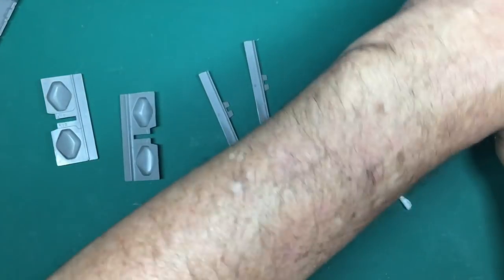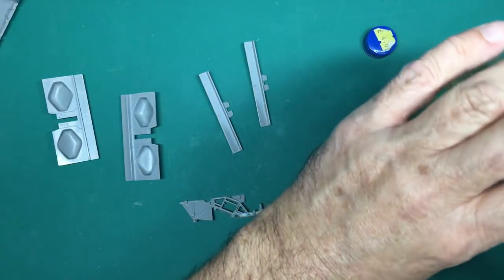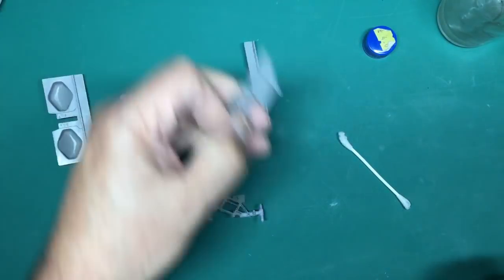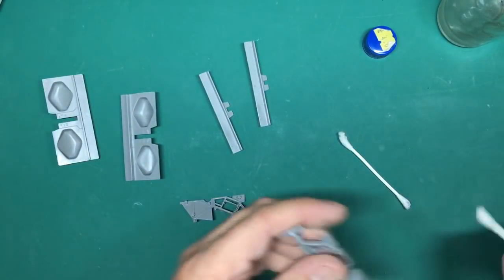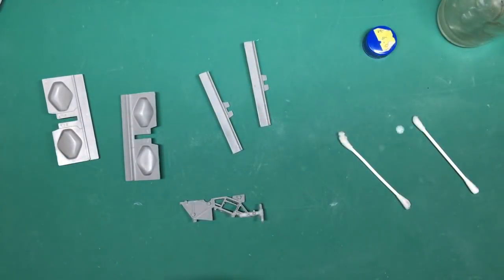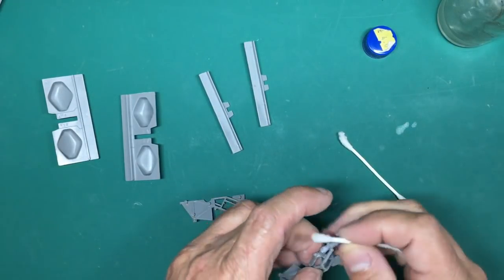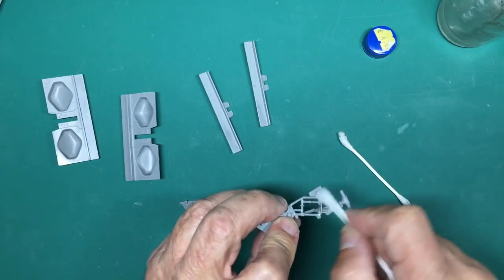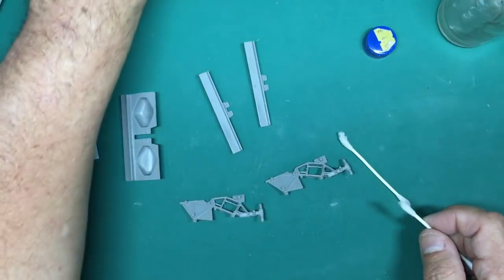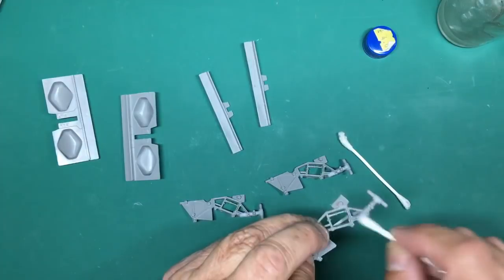You know, like I also mentioned in a previous video, I have sprayed many cars, and I don't mix the paint by weight or anything. Usually you'd have a cup like this that you would mix your paint in, and you've got a scale up the side. You have a rule type thing with lines marked on it that will have your 4 to 2 to 1 or your 2 to 1 or your 50-50 mix or whatever marked on there in graduations, and that's what you use. It doesn't need to be exactly precise.